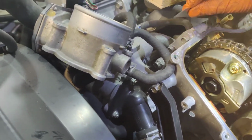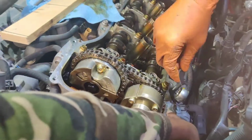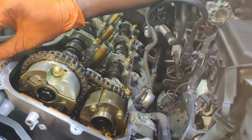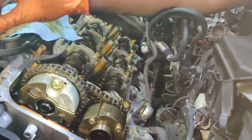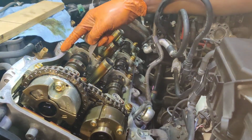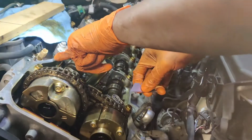And we're just removing a tiny bit of it. Honestly, because this side is the elevated side, it's never going to leak from that side. Well, this is our problem right here. I'll deal with that. Let's do the easy stuff first. Is there any on the 4Runner? Yeah, we're going to do all four corners. But like I said, this is just mainly because this is where the gasket is. This doesn't matter. This is on the outside either way. If you want to do it just to look good, fine. But it doesn't do anything in terms of sealing because the sealing surface is in the middle.